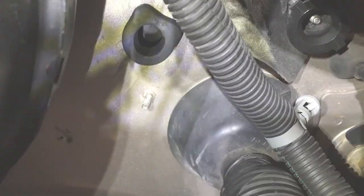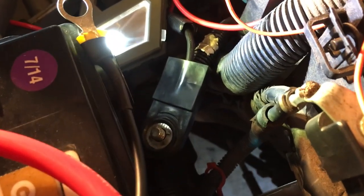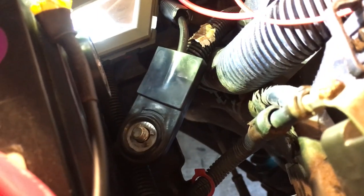I'm finally at a point where I've got all my wires ready. This is four gauge — I gotta shove that through, and then all my gauge stuff. I need to see whether there's going to be enough room or whether I'm going to have to poke another hole. I'm going to start with the fattest of the fat, which is going to be my four-gauge amplifier power wire. Anytime you're doing anything major on your car, especially with electrical, disconnect the negative terminal from your battery.